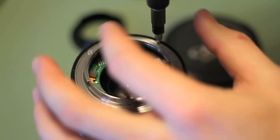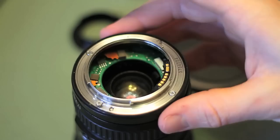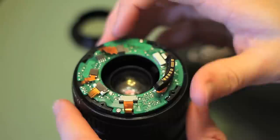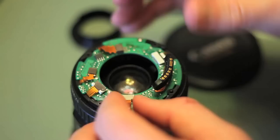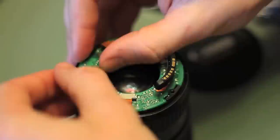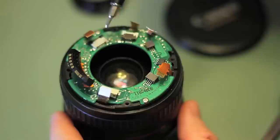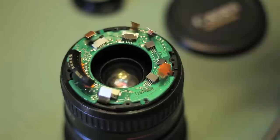The next thing to take off are these four screws on the top of the lens mount. This just pulls straight off. Now you can see the electrical connector circuit board here and you're going to have to disconnect each of these five bands from their connector on the board. You don't want to break these ribbon cables, so just gently pull them out. There are two little locking clips on the side of these ones — you just pull those out. The circuit connector board has two screws which are holding it down on opposite sides. You simply unscrew those and pull the circuit board straight off.